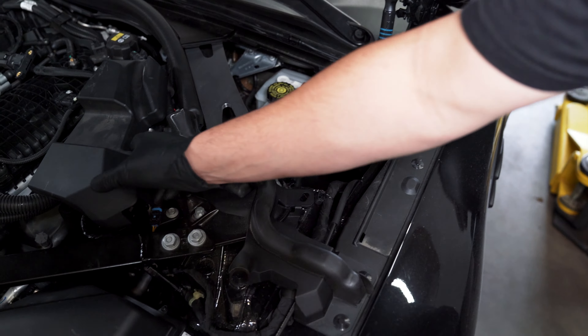Alright guys, so after much fiddling around with the routing of the wiring for the S58 JB4, we figured out the perfect routing that basically leaves all the wires in their natural resting position without any tension or sharp curves that could potentially cause the wires to rub, break, or chafe on something. The JB4 is gonna go here right next to the brake booster, sitting as high as it can on this strut tower. It routes right past this big bolt and the small bolt underneath your plastic trim panel, through this section under the strut tower brace bracket, and under the fuel line — which we found was best. It gives proper routing right between the outside pop clip and the connector section, underneath the AC line here behind the coolant pipe.